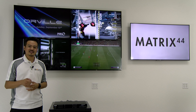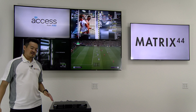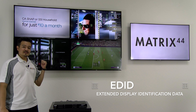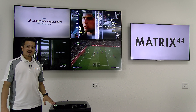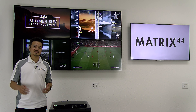There's no need to unplug and plug unnecessary cables or lug around devices upstairs and downstairs. One of the reasons why switching is so fast with the Matrix 44 is because of its advanced EDID management. Each of your TVs and each of your sources has a host of information stored within. The advanced EDID management communicates this information to produce the best quality picture and sound almost instantly.